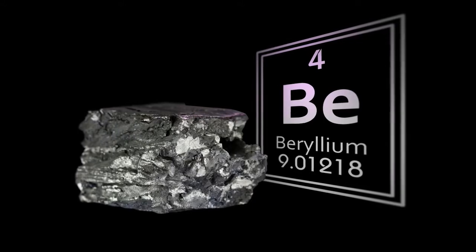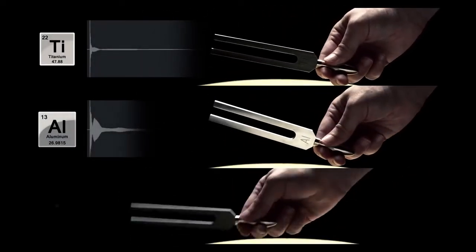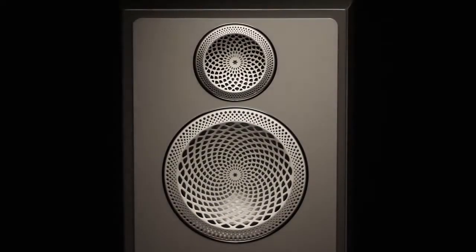One of the main technologies allowing us to get the results that we achieved was using beryllium. We are one of the very few in the industry to utilize pure beryllium. The 7-inch beryllium mid-range is actually used in all the Persona floor standers. Beryllium is very rigid, so it gives you a very clean output. The beauty of beryllium for the diaphragm material is that only the sound of the recording is reproduced — none of the harmonics or any other sounds that other diaphragm materials can introduce. Because it has that combination of light weight and stiffness, we can expect the highest performance out of beryllium for the tweeters and the mid-range.